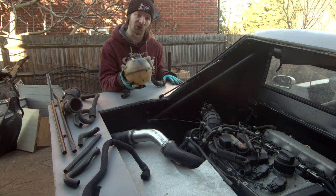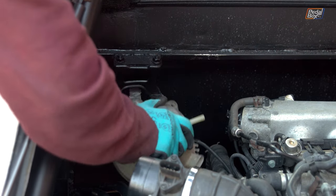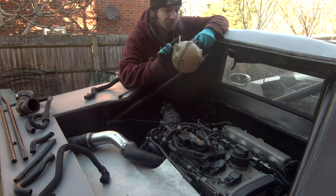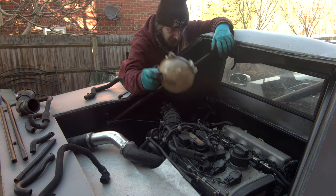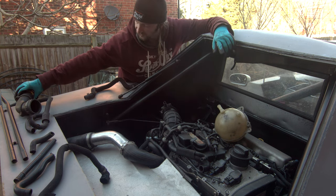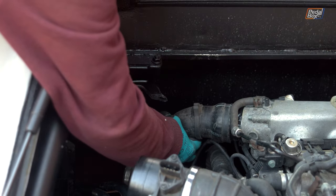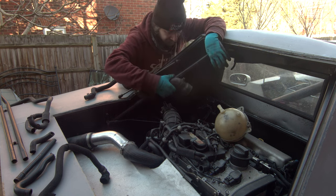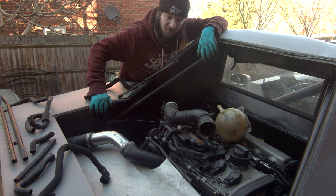Conveniently, the car is also on a good rake, which gets you a good view into it, because we're working on the floor. As you've seen a few times on the show now, this sits down into the bracket. There's a big pin on the bottom that locates it. Two screws on the back anchor it in place. For the plumbing, the hose outlet here is kind of in the same area as the boost pipe into the intake manifold. So before we can figure out exactly where the hose goes, we need to rebuild some of our intake system. This final hose comes up out of the second intercooler and into the intake manifold just around here. We're going to get that back together, then put the expansion tank on and plumb it. Once that's done, we can put our air filter and the final bits of intake plumbing on, which completes all of our boost system at last.